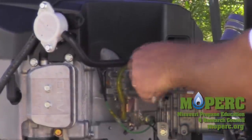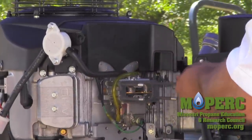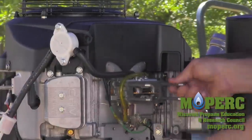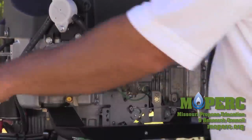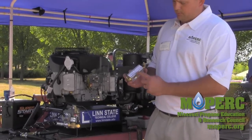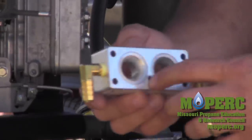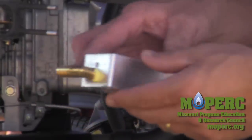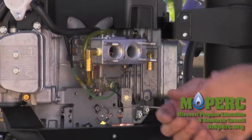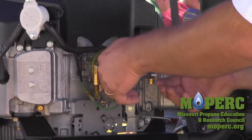This way our carburetor stays right in place and we don't have to chase it anywhere. The kit comes with a fuel block adapter that has arrows to show you the air and fuel mix flow direction. You can also see the different sides of the barrel intakes — the smooth polished side needs to face where the air comes across, pulling the fuel in through the Venturi slits inside. At this point we take the fuel block adapter and slide the additional gasket on that's included in the kit, because this is generally the time you forget and have to go back through it.